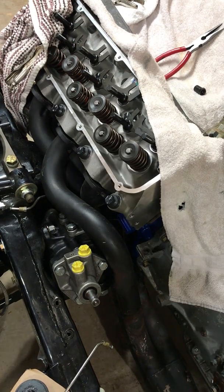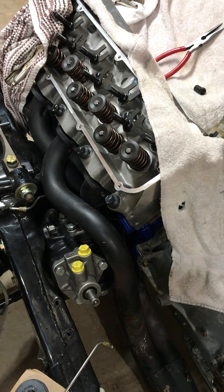Hey guys, what I'm doing here today — I've got super Cobra jet aluminum heads. Got to remove the inner valve springs before you can break in your flat tappet cam. I'm showing how to remove those and remove the valve retainers.